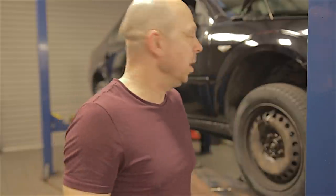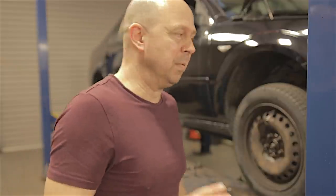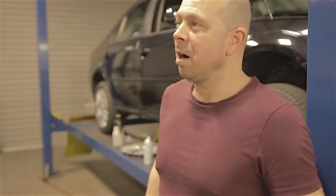The whole point of this video was just a check around underneath to see what goes wrong with them for MOT purposes. The Mark One and Two Mondeos have different suspension and there would have been a lot more to talk about. By the time year 2000 came around and these cars came out the suspension had improved immensely - apart from the bloody coil springs. So remember, if you own one of these, coil springs and wheel bearings are going to be your biggest problem. Once you get to the Mark Four Mondeos I can't ever remember having a broken spring - and the Mark Fives have never had a spring break. The suspension on the Mark Fours and Mark Fives is an improvement - they've become more robust.